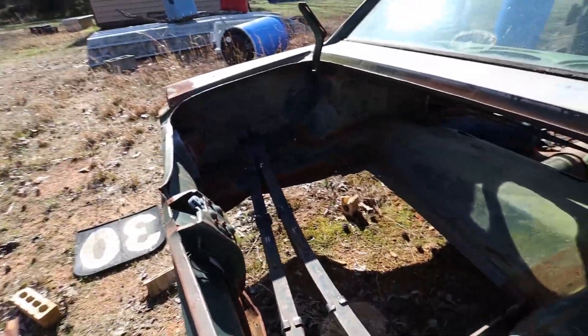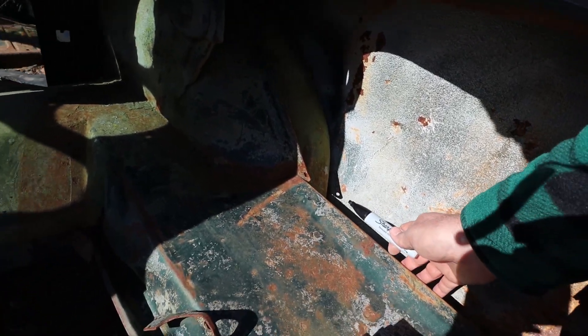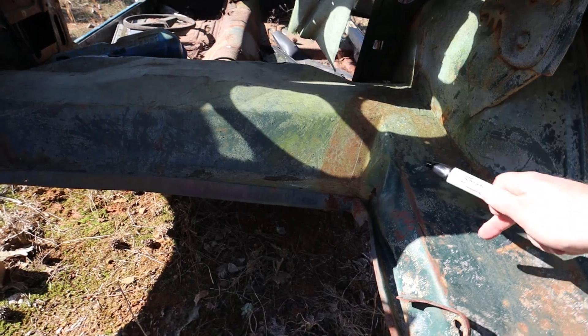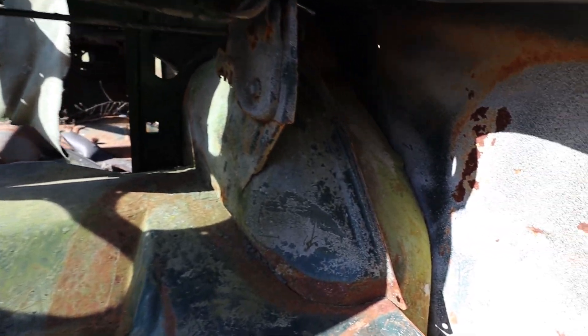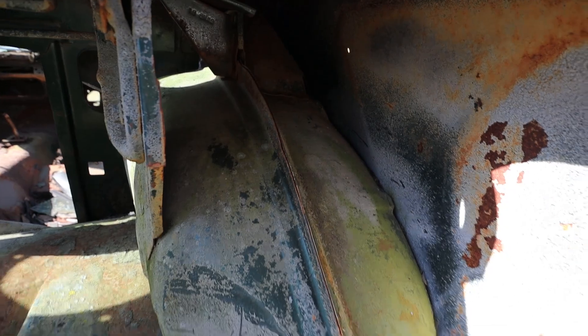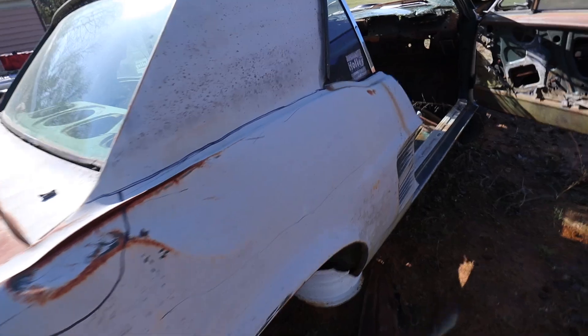In this particular car the drop-down panels in the trunk are not that bad — oh, they are too, they're pretty wrinkled up. I'd probably cut all this out and replace these panels, both sides. Now if you look at the wheel housings, they're actually in really good shape. Because of that, I'm going to cut this rear quarter differently than I normally would.